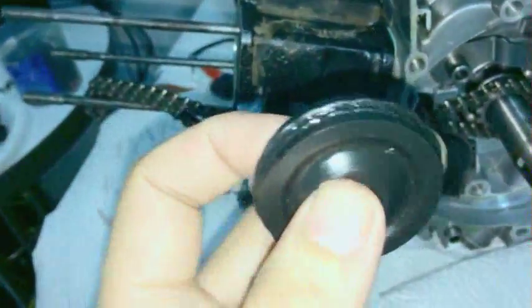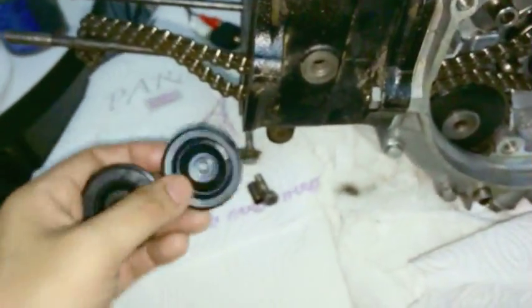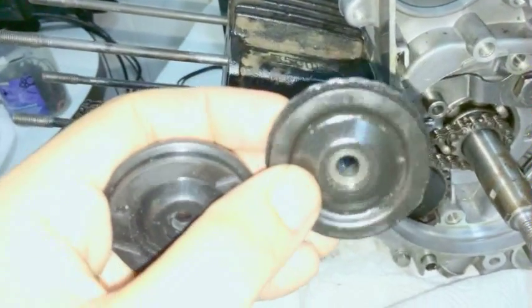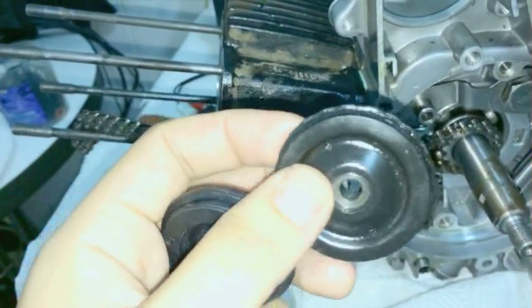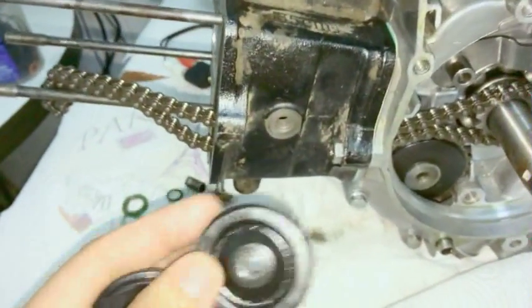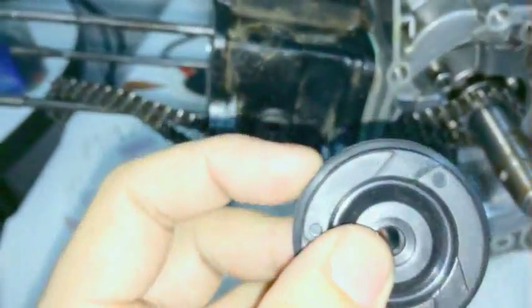This one's out of my original, I think it's the Astrea, can't remember. I've got about 15 or 20 of these laying around. You can check for wear, and it's so hard to find good ones over here. So you might ask why I'm putting in a fairly worn out one. You can see how it's got a bit of wear at the top. I'm going to wipe it off, but it's got a bit of wear at the top. It's really hard for me to find good ones where I live, so I'm going to put in a slightly worn out one. And when I say worn out, I mean it's still plenty good. You can see where the teeth were contacting it, whereas this is about how much rubber material you're going to have when it's brand new.